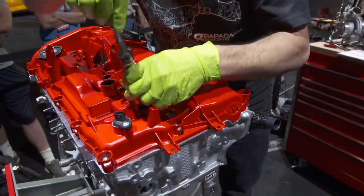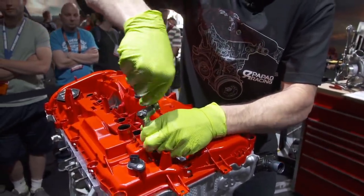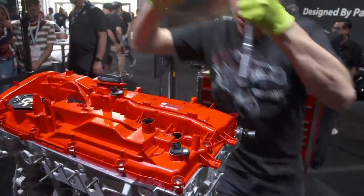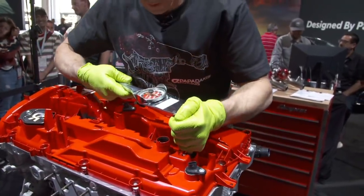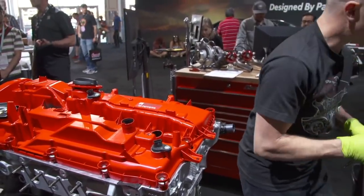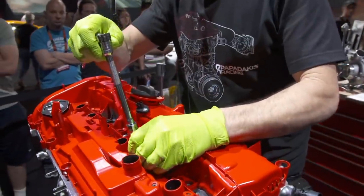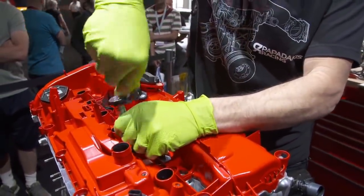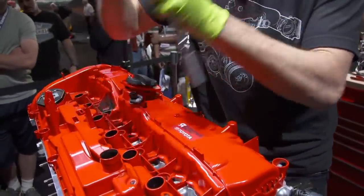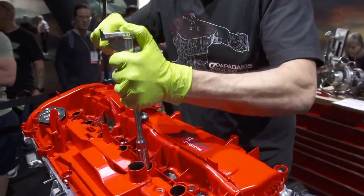I'm in the wrong hole. Because there's two holes. There's one for the direct injection and there's one for the spark plug. And the direct injectors we're not putting in this. We've actually plugged all of the holes. And I like to torque all of the spark plugs because the spark plugs do transfer heat in between themselves and the head. And if you have a consistent torque, I just believe that you have a consistent transfer of heat and you know it's tight and nothing should come loose.